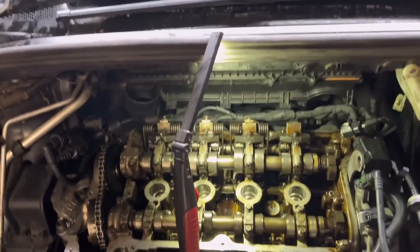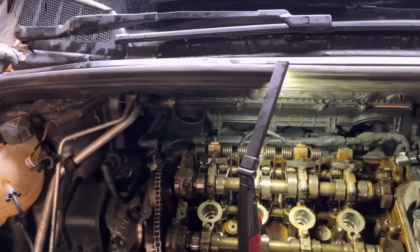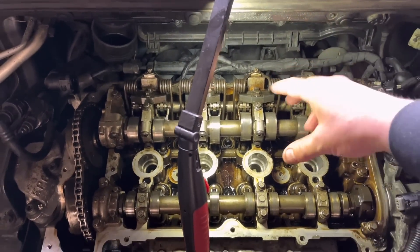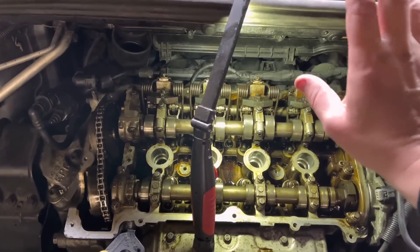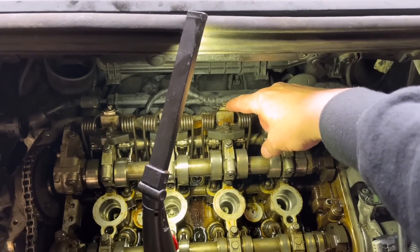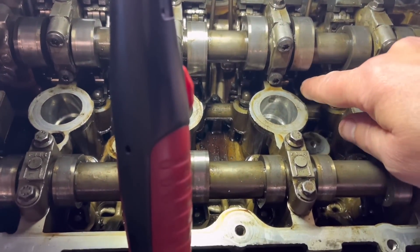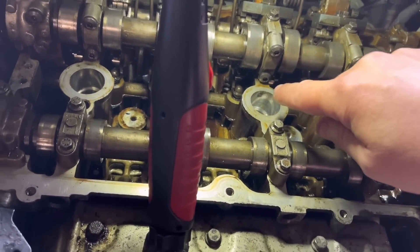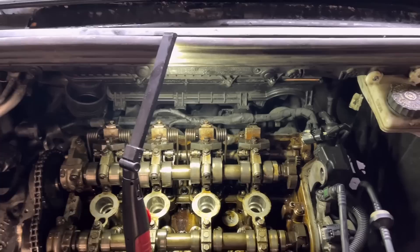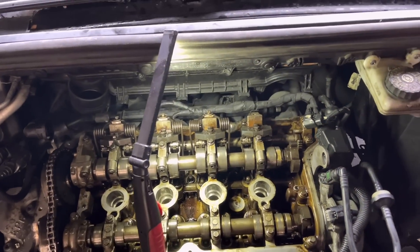What we've got here is a little Peugeot and it's got the same valve springs setup on the camshafts as the BMWs. As you can see, I've got three in. This is the usual — it's come from a garage where one of the mechanics has undone this top bolt here to release the springs to get it all apart, and it's sort of gone wrong. They haven't got the tool and they can't get the springs back in. The problem you have is when you do this one up you cannot get the arms behind these rockers. We've got three on already and I'm just going to show you how we get the other ones on.